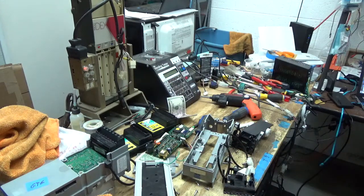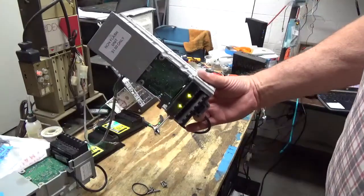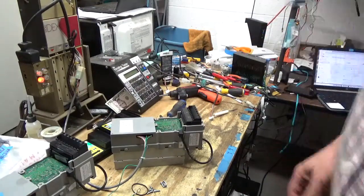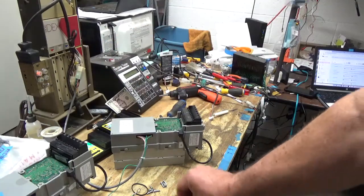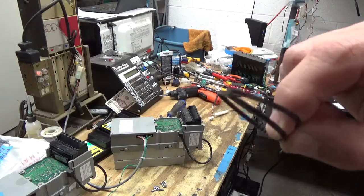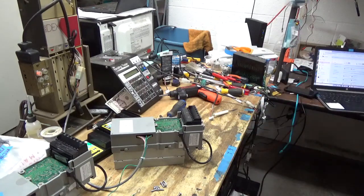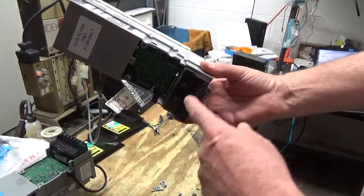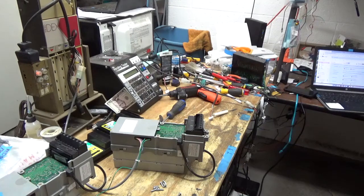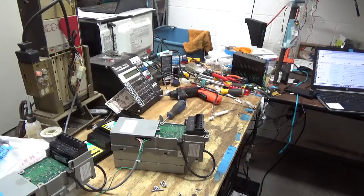We're going to put it back together and get it working again. We have it back together with two new belts in it — you can see the lights are flashing. It's a one dollar only unit. We have a quarter change because our tester is set on 75 cents. How these two belts came off the rollers and ended up wrapped around the axle, I just don't know. If it was on location in a machine, I know how this could happen — they put screwdrivers up in them and try to get whatever they can, which is usually zero. Both units are working, but the 24 volt and 110 volt question remains. Thanks for watching.